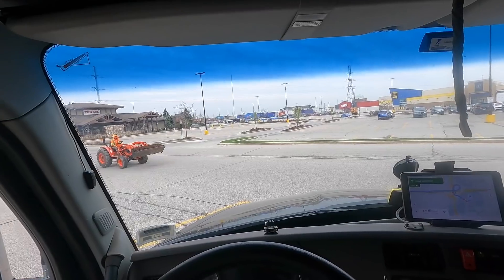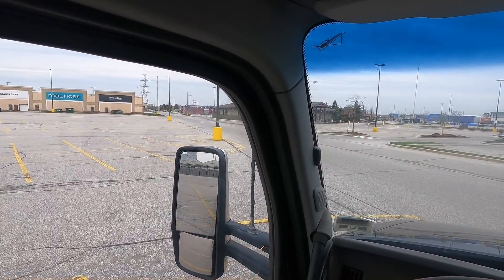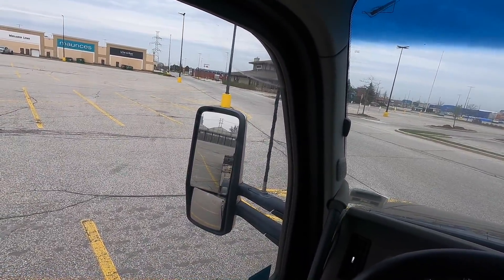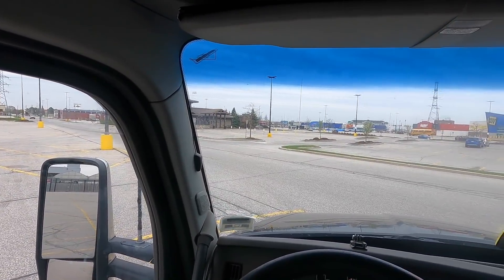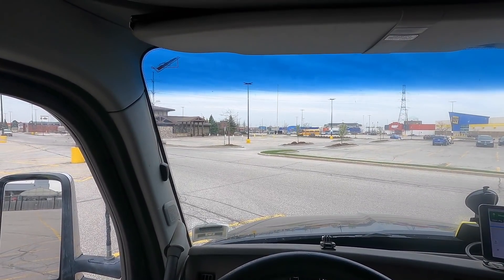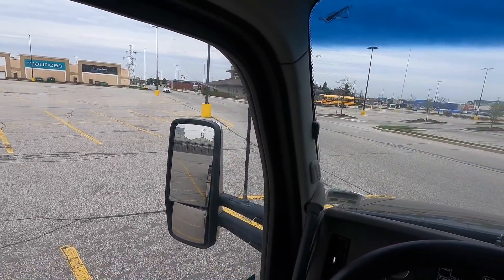Maybe once in five years has somebody given me the correct weight. I hope it's lighter. As soon as I enter Illinois they allow up to 100,000 pounds on the back. My factory rating is 20-20-23-23-23-23-23-23 in pounds, so the steer axle is 20,000. The pusher axle is also 20,000, which makes no sense — when you spec a truck like this, make sure they give you the same rating on the lift axle. The last two axles are 23,000 each, so it's a 46,000-pound tandem.